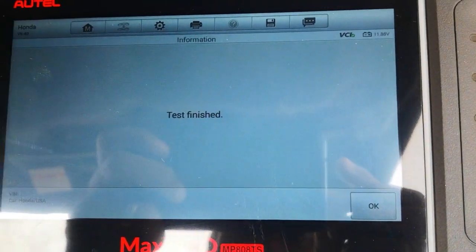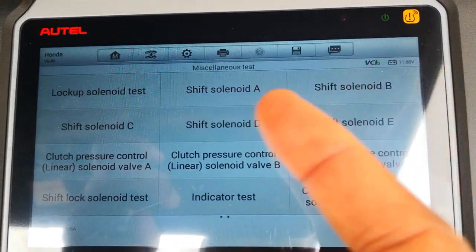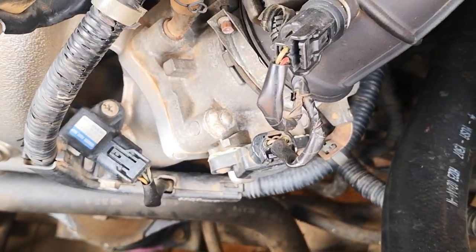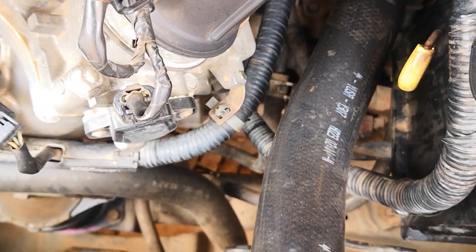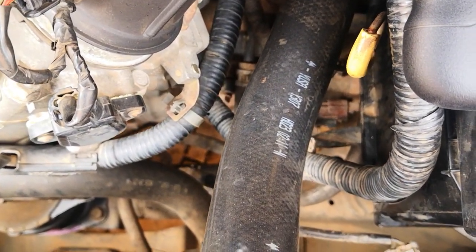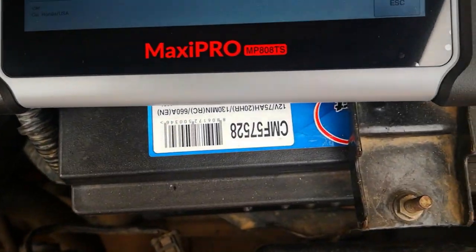Test is finished — you say OK. You can go ahead and test all the other shift solenoids. That's one of the very good features of this scanner: it can help you isolate solenoids that are bad, especially if you have solenoid-related codes. So that's it — very short video. Thank you very much and see you on the next one. Cheers.